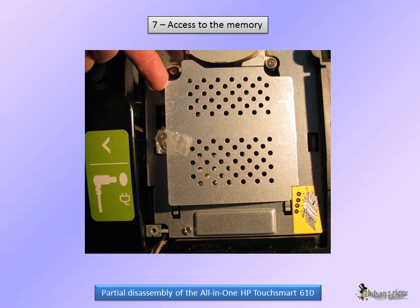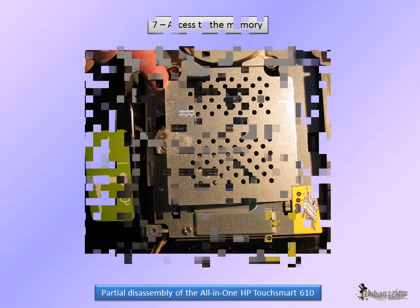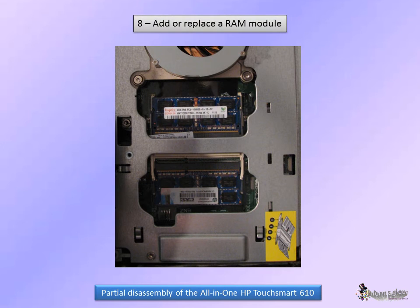For the memory, you need to unscrew this cover. Since the screw is a little special and easy to lose in the holes in the box, you'd better hold it in place with a piece of tape. The cover is really easy to remove then. You can remove the RAM modules now. If you're not used to doing this, there's a diagram that explains it under a yellow label. In order to remove each module, you just have to pull outwards each of the clips. It then pops out and you may take it out of its connector. To insert a module, just push it all the way into the connector, then push it back down. The clips will automatically fit into their original position.